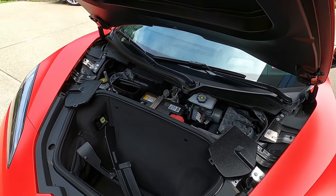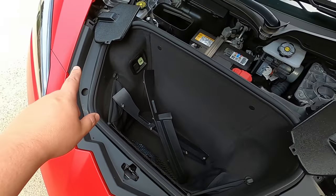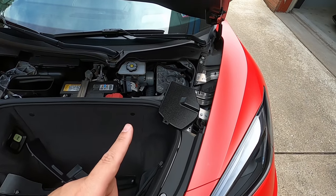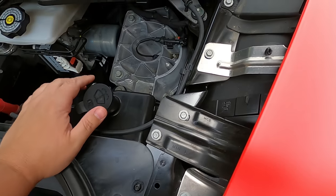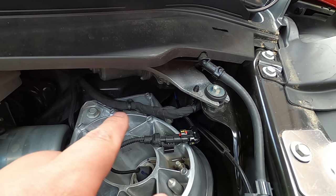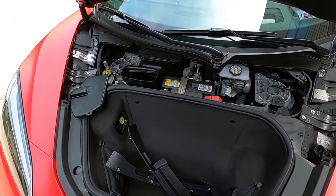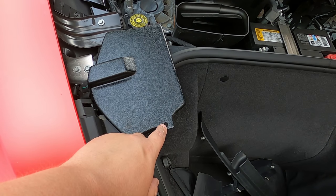You're going to hate me because this is not a completely tool-less installation. There is one 10 millimeter bolt that is going to require a 10 millimeter socket — other than that, totally tool-free. I said tool-less in the beginning because to remove the plastic around the frunk you can just grab and pull it, and I really thought the whole installation was tool-less. But there's one bolt that goes through on the driver's side, and then on the passenger side it's just a zip tie that holds it down. So unfortunately you're going to need a 10 millimeter socket. On the driver's side, we remove a 10 millimeter bolt on the back side of the windshield washer fluid tank, and also remove a wire harness held in with a Christmas tree style clip — pull that out and slip the cover underneath it.